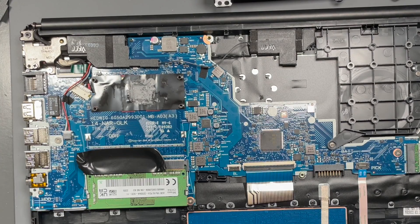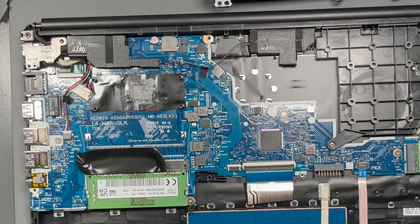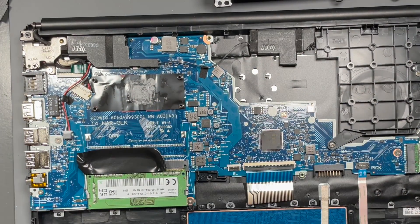I can't see where the eMMC storage is. I'm wondering if it's on the flip side of the board. Moving down to the RAM — it really is so slim. You have one slot where you can tell they could have easily just populated it with another slot if it was a mid-level laptop, but this is just single channel and it is upgradable. The maximum amount of RAM that the Gemini Lake Refresh — the Intel Celeron N-series, which is a generation 9.5 part — can handle is eight gigs. So I did order eight gigs for that.